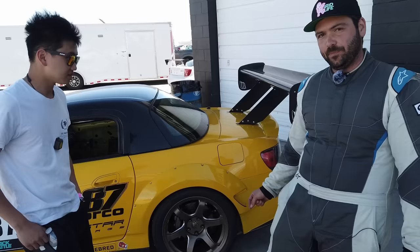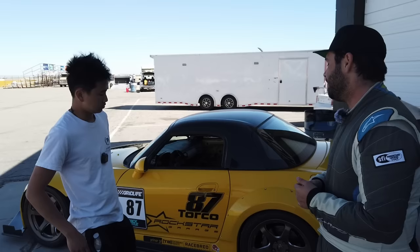So it is the Ford 8.8 kit. Yeah, so the benefit of that is quick swapping. You can also tear it open, change the final drive, and do all that fun stuff. Because the S2000 is a little bit of a magic box. If you open up that diff, they don't usually last. There's a Honda magic to it. At least that's what we've seen. Right. So we just went with the Ford 8.8 rear, and it's been solid.